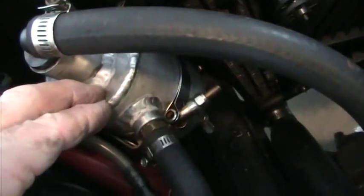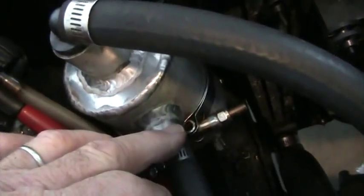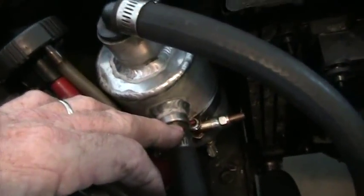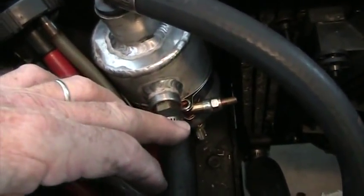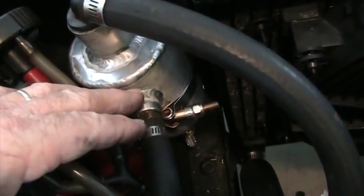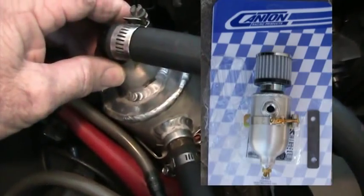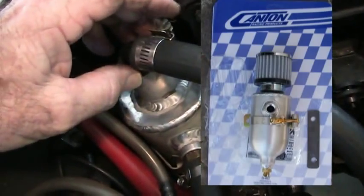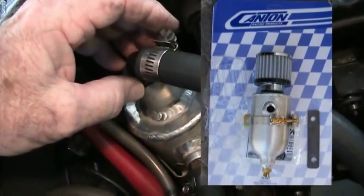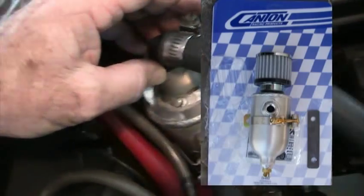There are baffle plates inside to stop that moisture from trafficking, so it puddles down into the reservoir. It's not much — just a little drip here, a little drip there. It may take you six months before you even get anything out of it. But the rest of the air travels upward and comes up. They usually have a big stand-up filter on top when you buy it. Well, that is what I don't want — I don't want a filter on there, and I don't want that air going out in the atmosphere and drifting back to my driver compartment.